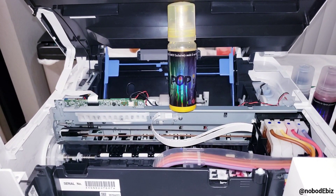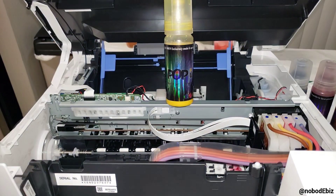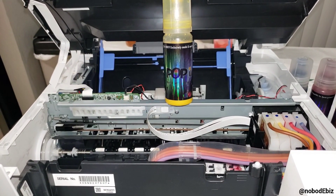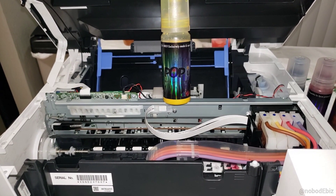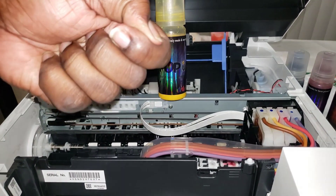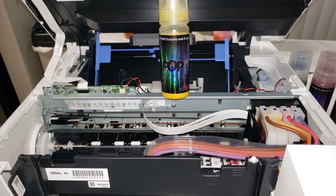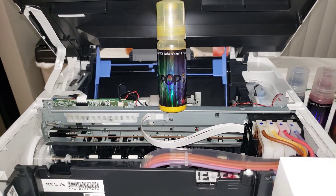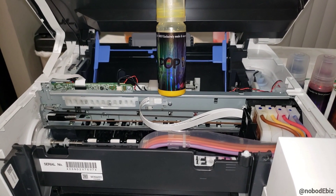I understand the panic. I'm pretty sure you've seen my video where I converted the printer, and maybe the video where I switched out the ink, and then the purge video. First things first: the purge video was a mistake on my part, so you don't really need to do that. The first video, I switched out the ink but had trouble pulling the tubes off from the top — there was no need for that because I could have done it from the bottom of the dampers. I never would have had to purge the way I did. Just go from the bottom of the damper — save yourself some time. Don't be like me.